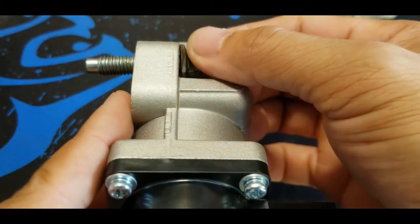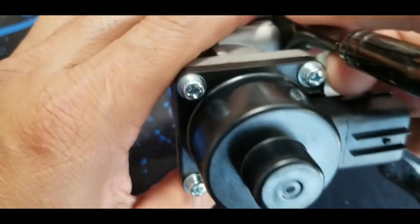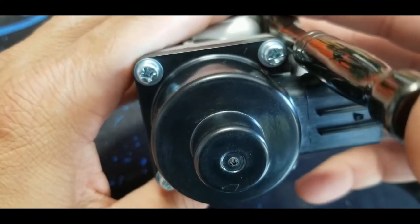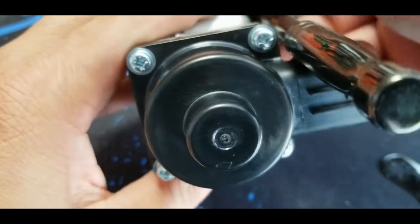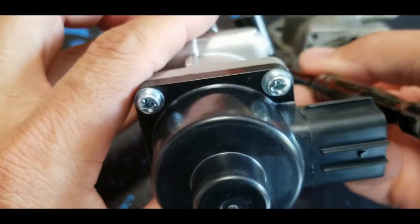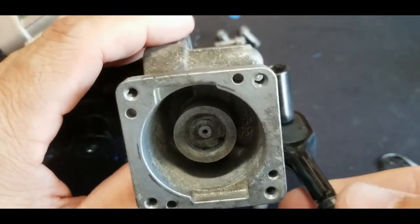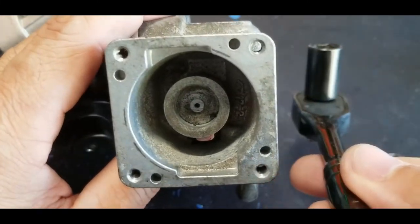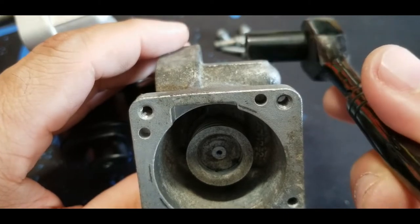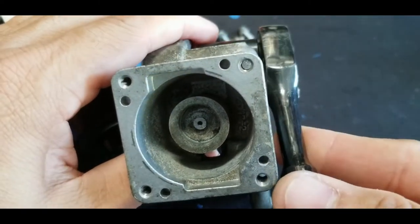So the most difficult one to access is the one at the back. As you can see here, if I put my socket here, there's no way for me to pull the ratchet towards me to loosen it, because this thing is in the way. Even saying that, probably even positioning my socket is going to be hard, because this is in the way. So what I did here is, let's do the old one, I went like this, and on the right side is the rubber hose connector. So I went like that, and then turned it like that to the left, and then positioned it to the bolt, and I have room to pull the ratchet to loosen it.